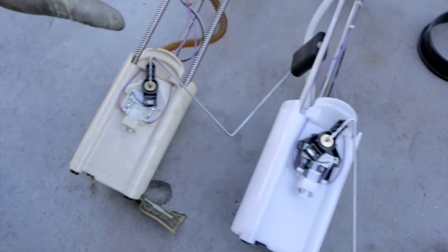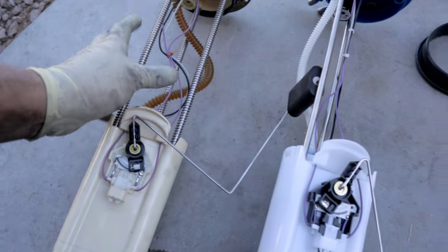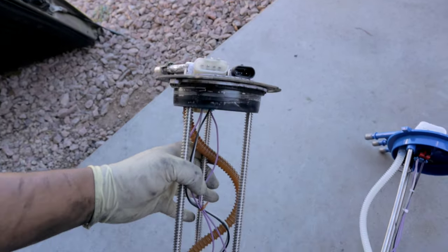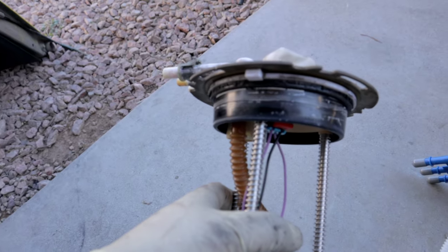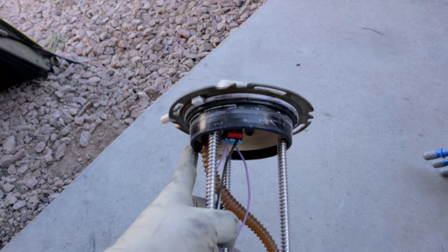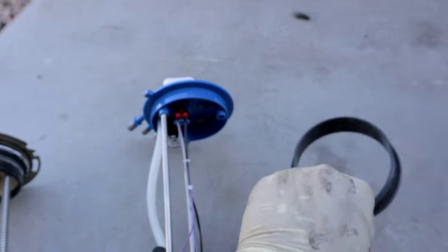So that's what's wrong with this guy right here. The floating sensor here is no longer reading the fuel, and the evap sensor on the top is defective. Also, it's important to replace your fuel pump gasket. This pump looks like it hasn't been replaced ever. So we have a good brand new one right here that's gonna go in